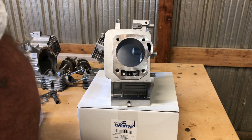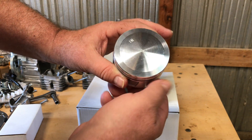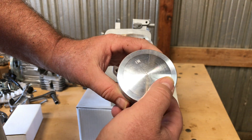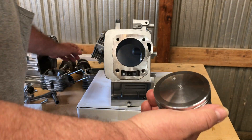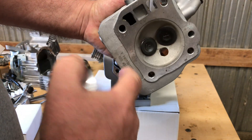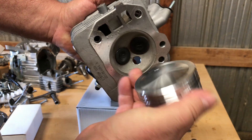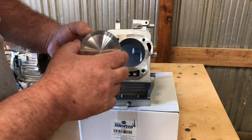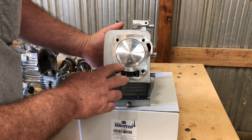This one is also the 72mm bore. Now the piston I'm going to be going with is this raised dome, and that's going to be custom tailored to fit this engine build combination. The reason I want to use this raised dome is because with that hemi head, that's a lot of space inside there, and that dome is going to fill up quite a bit. It'll help raise the compression. I just have to cut some valve reliefs, and unfortunately I'm still waiting on my valve relief cutters to come in.